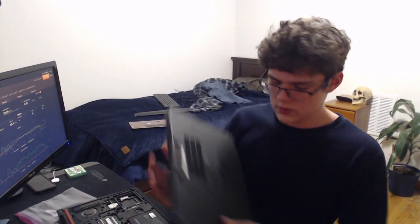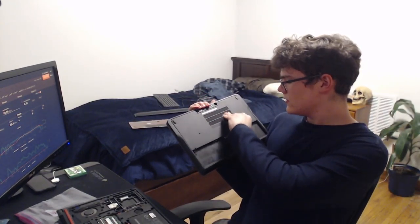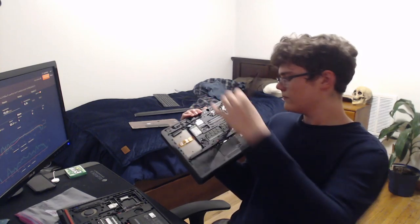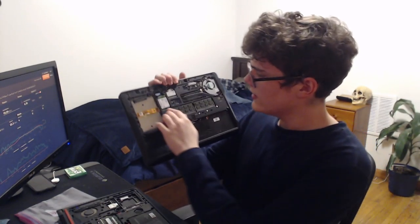The problem is — let me open this up. You gotta get the battery out, and the screws aren't in so I can just pop this off. This SSD right here is mSATA. The only SSD slot in here is M.2. I got this adapter for my dad that's SATA to mSATA, so it plugs into the SATA on here and then I can plug in this mSATA SSD. That's the plan.